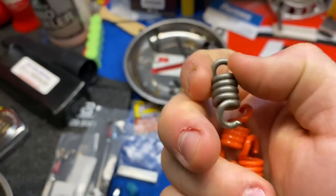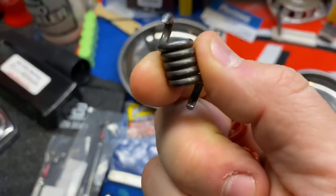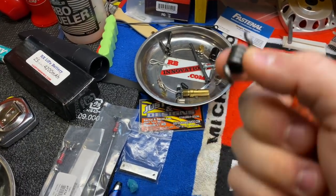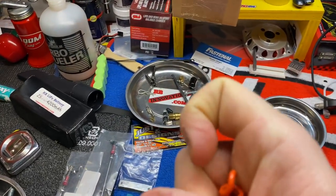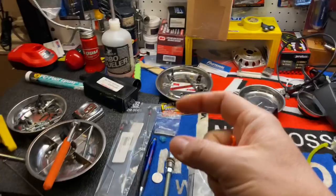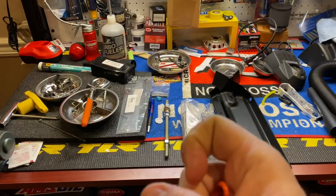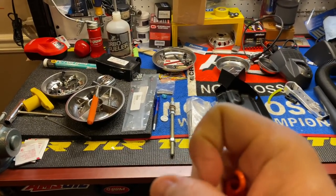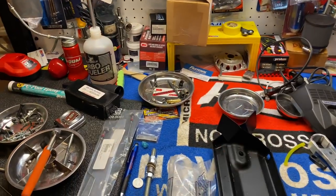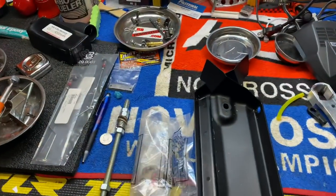I got another one here — just way too much. It's so stiff, look at that thickness. Sometimes you even have to drill out the clutches. One of these is 12,500 RPMs — that thing is already revving high not even moving. It launches crazy but I don't like it at the light because sometimes if you're nervous, if it's sunny, or you got a little sweat in your eyes, at those RPMs the car might move forward and you're red-light disqualified. Those high-rev clutch springs screwed me up last year. 9500 is high enough.